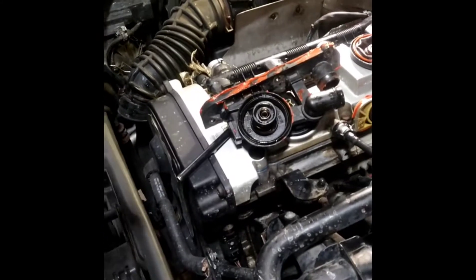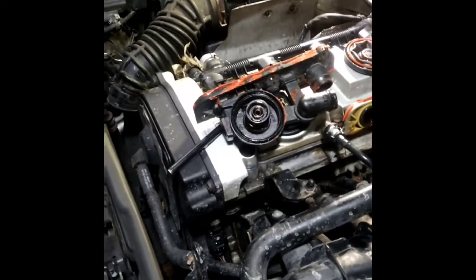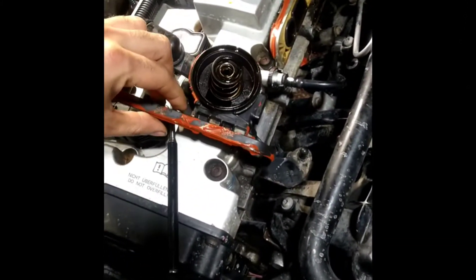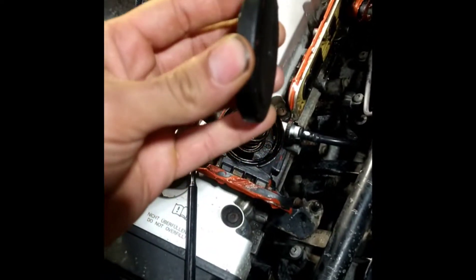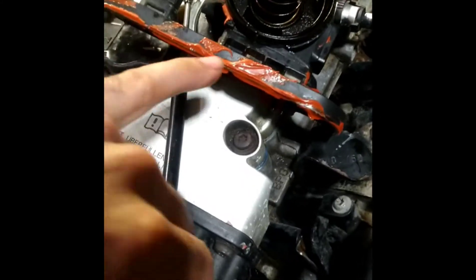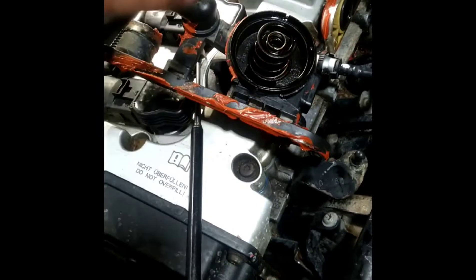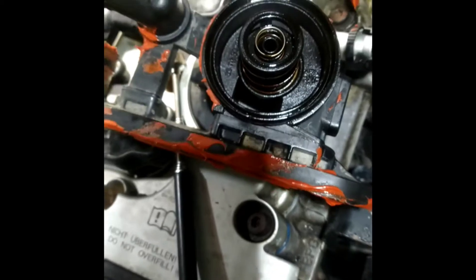Here's what I found. Upon seeing smoke come out of here, I always like digging deep and finding more thoroughly what actually caused the problem. The way I removed this — you can see how the cap is — this is probably the OEM one from the factory. All I did was put a screwdriver right here through the front and pry it off. I did not put any of the silicone on — this was already there before I started. The previous mechanic just tried to cover up the problem, hoping this would fix it, but really it was just blocking the air out of this hole because it was broken.